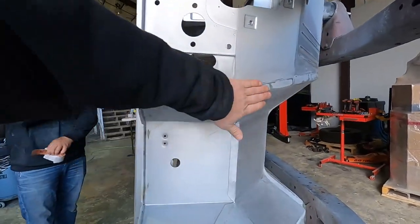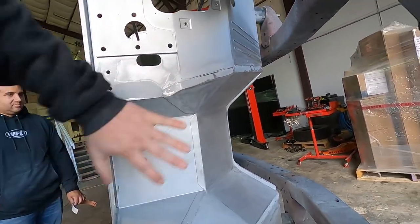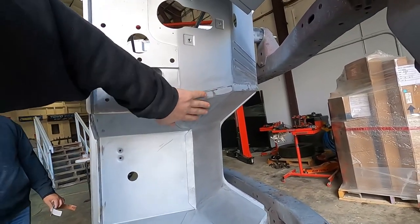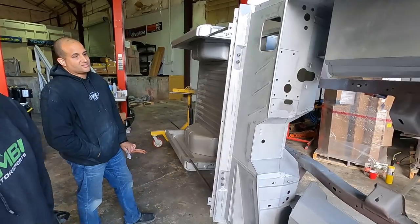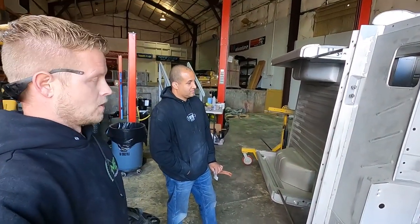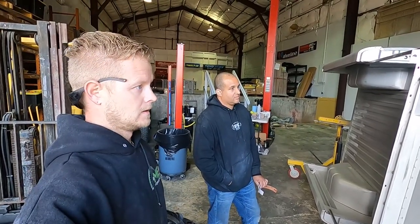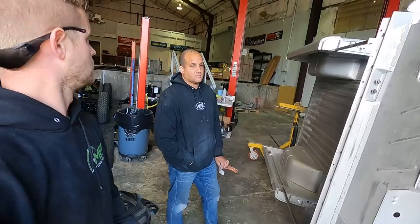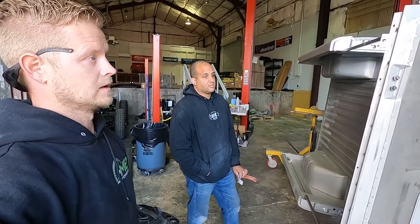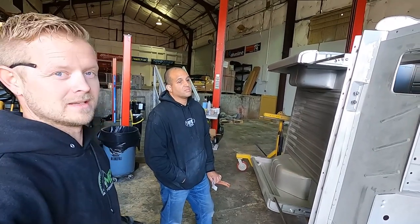Stereotypes aside, this is what we got going on. It all turned out really well — you can see where there were low spots but it is perfectly smooth. Once it's painted, you're gonna wonder how it was even attached. We just welded it, and that's why we did this whole process — to get rid of the low spots from the welds. The plan for next week involves seam sealer, epoxy primer, and prepping all the other panels that were removed. Hope you guys are having a good week, staying safe out there — we'll see you soon.